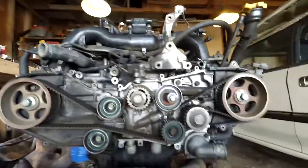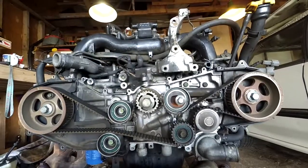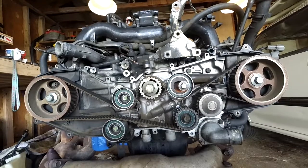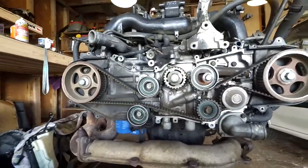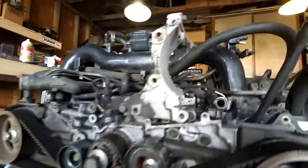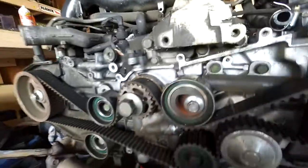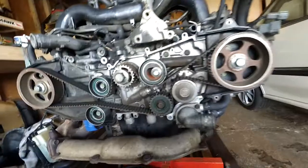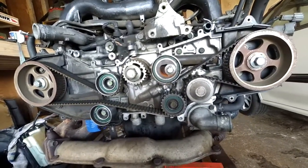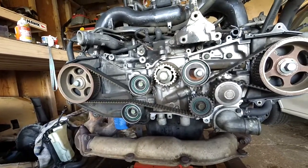So this engine, for the 30,000 miles I've been running it, has had a slight knocking noise. It wasn't quite like a rod knock — just a slight knock at part throttle — but it never got worse. I drove the absolute shit out of it for far more miles than rod knock would ever last. I kind of attributed it to piston slap since the block has been rebuilt. But what I found was that the tensioner I can actually push in by hand — it's just complete crap. What I'm hearing at part throttle is this tensioner rattling because it's not holding pressure. I think it's fine under load, but as soon as the load comes off it rattles. I'm very glad about that because it means the short block should be good to go and I can just do a straight up head swap.